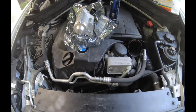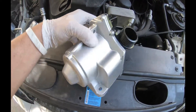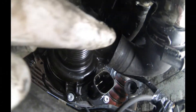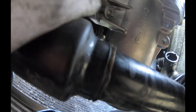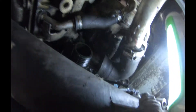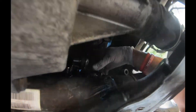We're gonna install the new water pump now. This is the original one with the BMW Group stamp — two years warranty. These bolts are designed to be installed one time. I fit this hose through the inlet manifold of the water pump without fastening the screw clip yet, then I put in one of the bolts. I'm gonna tighten this bolt, install the second one and tighten it, and then tighten the screw clip. Here is the pipe and the screw clip — the connection is installed and totally fitting inside the socket.